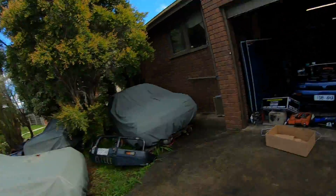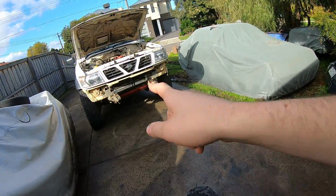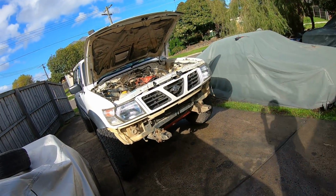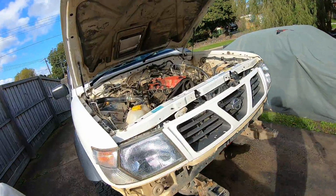Alright guys, so it's about 1 week later, as I have been on holidays, so I thought we'd give it a break for a week, and now I'm back at it. It's been a bit wet, as you can see. If you watched my R32 video that I put out last week, I broke my jack and I've got a new one, thank God. So now it'll be easy, because when I take the engine out of the Patrol, which is over here, I've got to jack it up and take one wheel off just to get the sump to clear with the engine crane. So that helps so much, and I can jack the gearbox up just a little bit, to get to those 2 bell housing bolts at the back. So let's do that now.